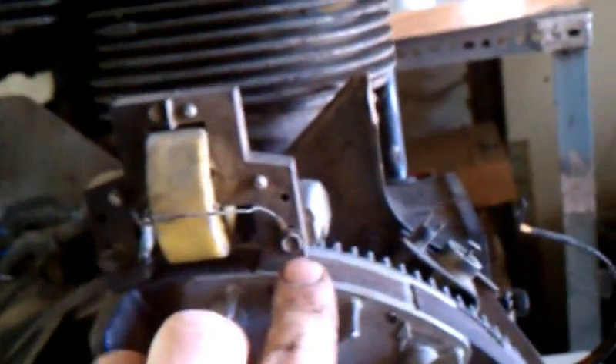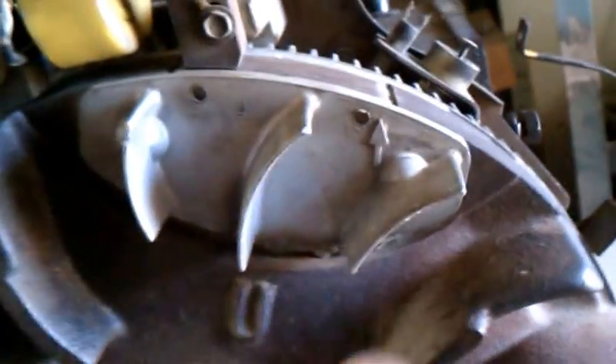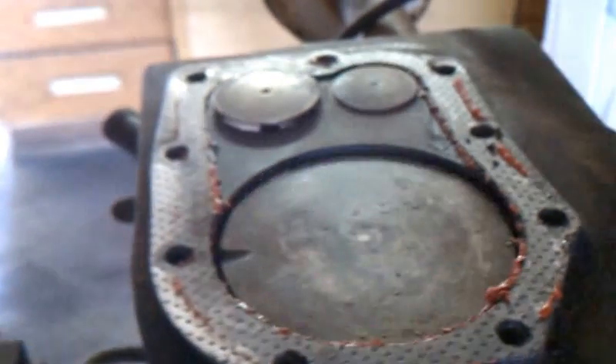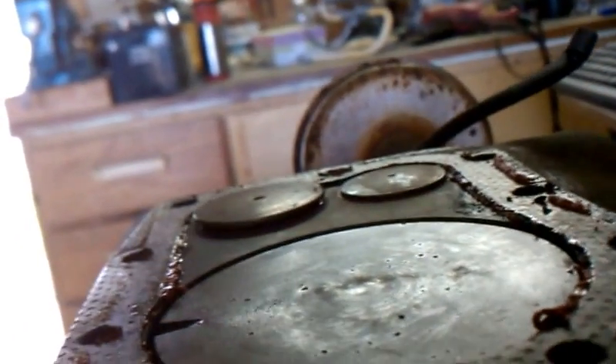So, next thing — the timing marks. There's an arrow right here, and my finger there on the bracket that holds the coil. Just timing there. And then this one here on the magnet on the flywheel. Looking across — going backwards, you can see the intake opening. Then going clockwise the way it normally runs: piston's top, transfers over, exhaust opens. Right where they're about even, I think, is there — which is interesting, because it looks like they're both open for a fraction of a second.